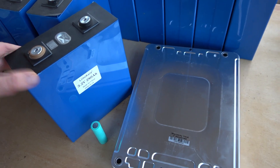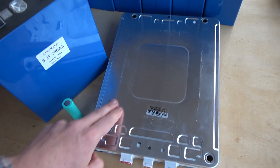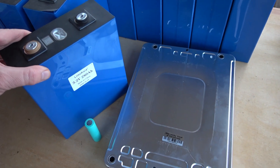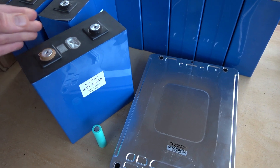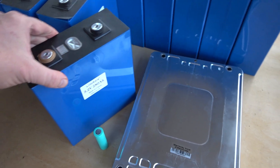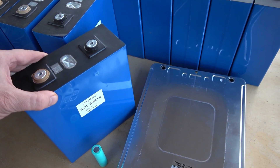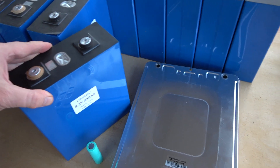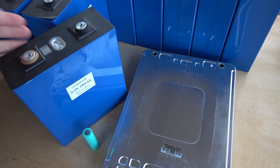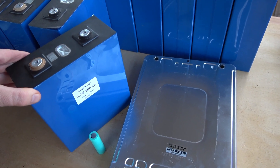If you're going to put a more expensive power dense battery in something like an Audi e-tron or a Porsche Taycan, you can do that even in pouch cell format. The Chevrolet Volt has a very expensive battery — even though it's significantly smaller than what's in the Chevrolet Bolt EV, which is a 1C battery as energy dense as the Tesla 2170 battery, but it's nowhere near as power dense. Where you win out with the Bolt is you get it at a roughly 30% discount over the equivalent size Tesla Model 3 2170 battery. So everything has its trade-offs.